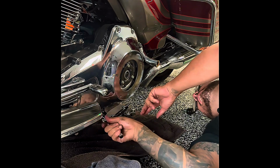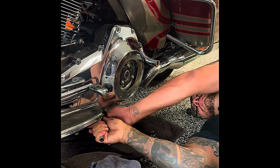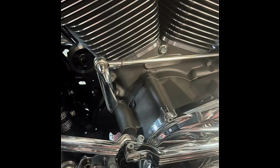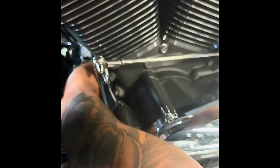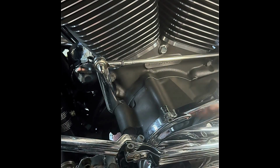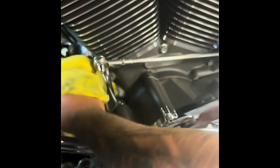Tighten it. It's just not too tight to where you're gonna break it. Alrighty, now that we filled up the oil filter canister about halfway up, we're gonna hand tighten everything. You're gonna go until it's snug, and then you go about half a turn more or so. You don't over tighten this, there's no need for it. Okay, that's pretty good. Good to go. All right,